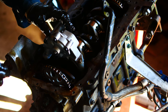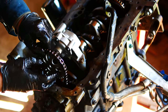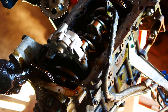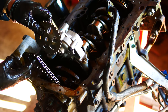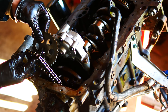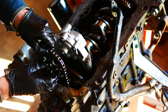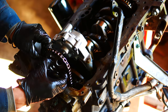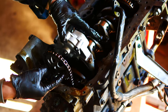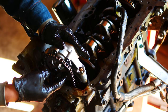So now that cylinder one has been upgraded, I'm going to reinstall the oil pump. This is a new one, where luckily I've got a fresh bolt for as well. So basically, all you want to do is pop this back on and estimate where the little, it's not a perfect circle there. There's a sort of straight bit which helps to key it to the right angle on the oil pump itself. So just kind of guess, but you can adjust this in a second, which you'll see. So put that where it should go,